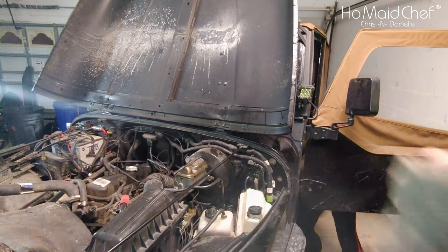Okay, guys, this video happened over before the accident and then after the accident. So yeah, it's a lot of video. Sorry. But the clutch works. All you have to do is take off the slave cylinder, hang it down, let it dangle, and then come up to the master cylinder and kind of remove that so you can maneuver around to get the air out. It does help if you have somebody else there so they can push the slave cylinder and get all the air out.